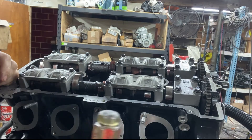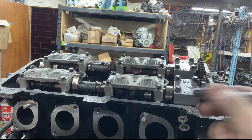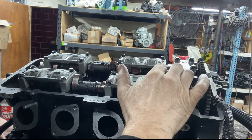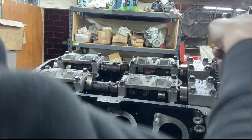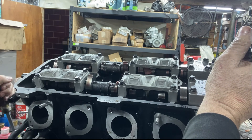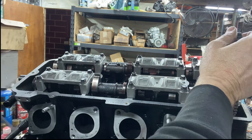Okay, got that one lined up. Let me come back just a tiny bit - and that one lined up. Now I need the engine at top dead center. I'm going to go on number one right here. I'm going to have to rotate the camshaft to get the cylinder to TDC. Right about there - just top dead center, right there.